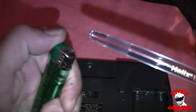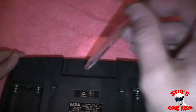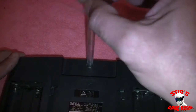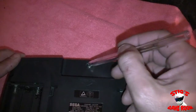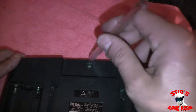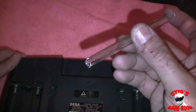For this pen I'm going to use the narrow end. What I'm going to do is take my lighter and melt the end of this, and when it gets nice and soft — almost runny — I'm going to push it down onto the security bit and hold it in place until it goes hard. Then once it's hard, hopefully we should be able to turn the security screw with it. These security screws have been in for anything up to 20 years, so they can be extremely tight, and a lot of the time they'll release with a click.